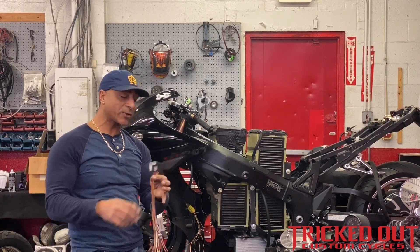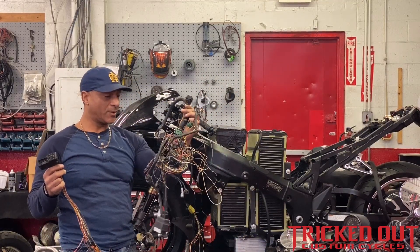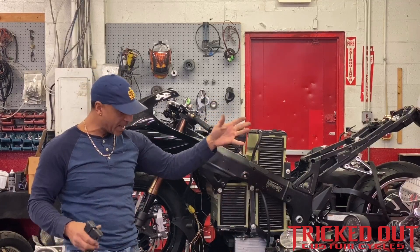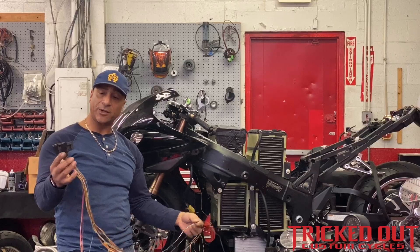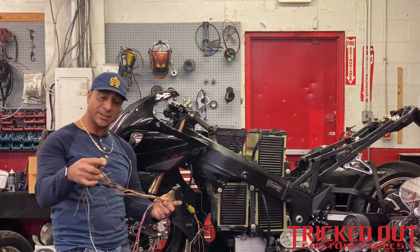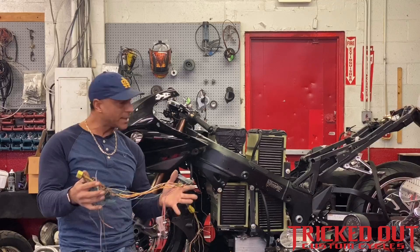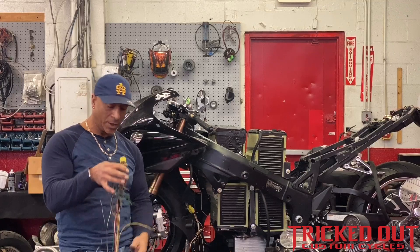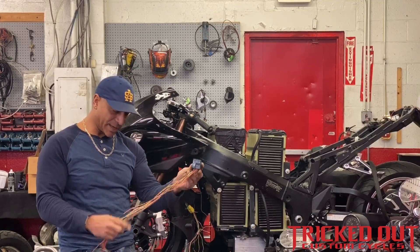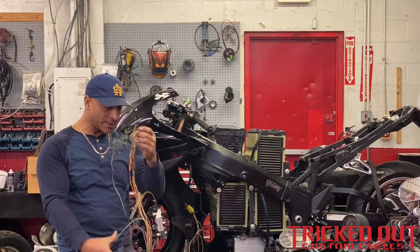What I just did is take a factory wiring harness from the Hayabusa and dissected all the stuff I don't need. All of that is fuel management and everything to run a standard combustion engine, so we're not going to use any of that. I could have simply made a wiring harness, but I figured it'd be pretty easy to recycle the wiring — there's nothing wrong with it. This will plug into the left side bar switch, which is going to control our headlights, the horn, and off of that I'll run the brake light, tail light, and separate relays that will operate the turn signals. Basically just going to use three or four fuses out of this unit and make it a lot easier — you don't have to purchase anything.